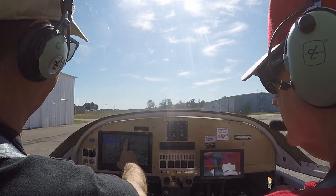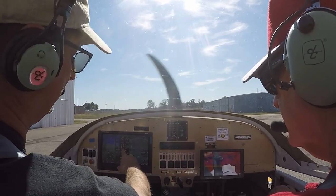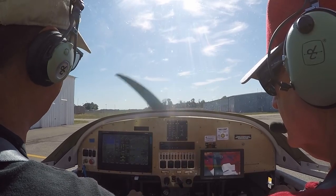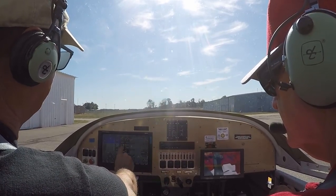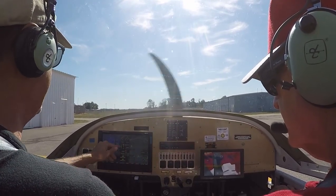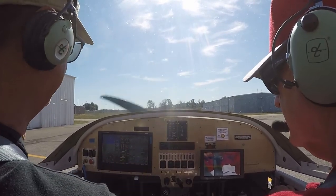This is our fuel — 15-plus gallons. This is our tach, so that's our RPM. Fuel flow, which is really only an approximation. Fuel pressure — as long as it doesn't go crazy, we don't much care. Oil pressure is right in the green. Oil temp on a hot day will get right up into that yellow. We really want it to get up to the top of the green and bottom of the yellow to burn the moisture out, because it hasn't been flowing for a while.